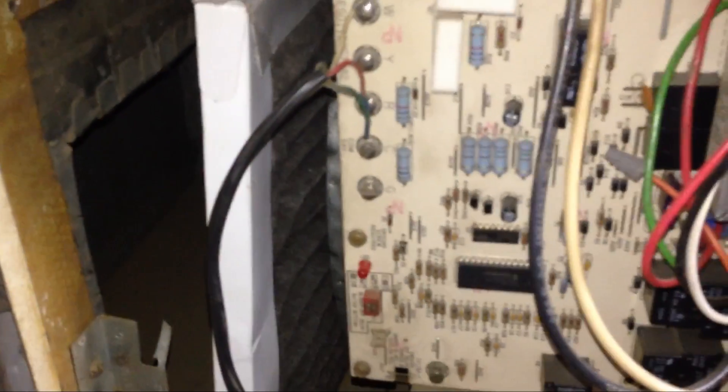And as long as we're down here, these are capacitors. You might not want to mess with these, but you can tell if they're blown because the tops will explode on them — there's kind of a cross where those tops will explode outwards and they'll have a bubble on them. So that could be a problem too; in this case mine are fine. So I'm going to go ahead and start this up. I'm going to use the safety lever — this is the door panel — so I'm just going to simulate closing it. And you see the bottom fan will kick on.